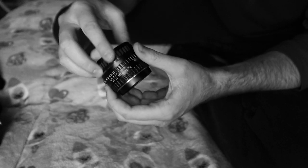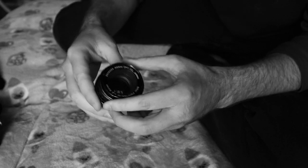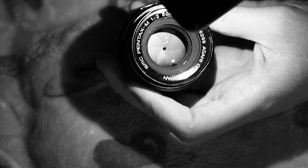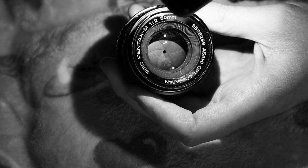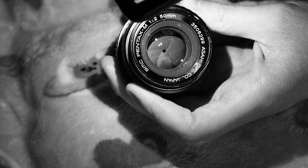that's a good indicator, at least, that I can tell. This is the first lens that I bought with it, and of course it has the issue. Right down there at the bottom you can kind of see it's starting to really leach out. And the discolored aperture blade right next to it there — yeah, that's a sign.